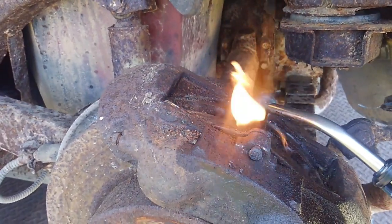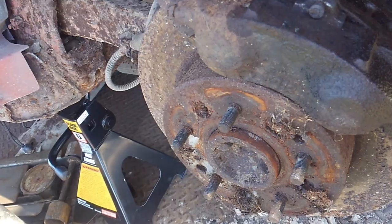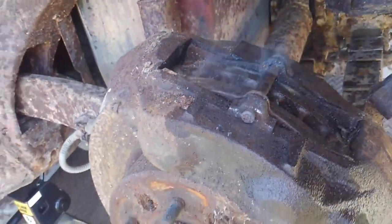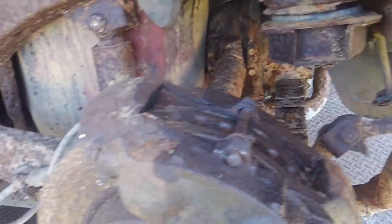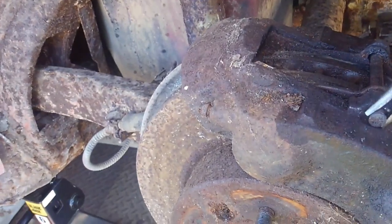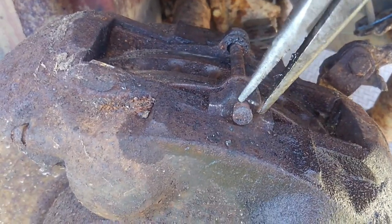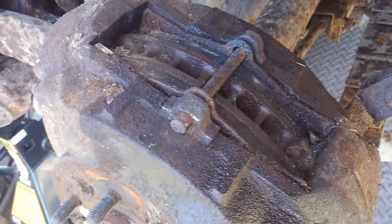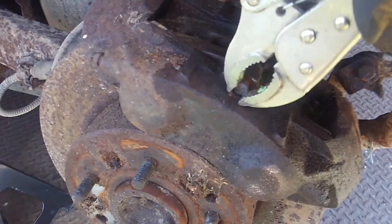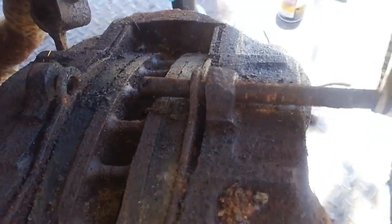I'm kind of just dousing this as much as I can so I can get in there and get this done. Of course if I set the brakes on fire we'll have a whole other problem. Let's see if it'll cooperate on camera at least. There we go — let me get a good grip on this. It moved a little bit there for me. I'm going to have to two-hand this so let me work on this pin real quick. I'll be right back. It looks like that's going to get it — got our vice grips on it and there it goes. So that retaining pin is the one on the C3s that holds the calipers through the top. When you buy a new caliper set or a rebuild you'll get a new pin, so you don't need to worry about saving that old rusty hardware.